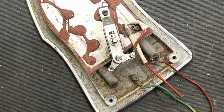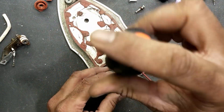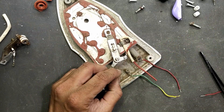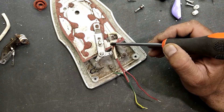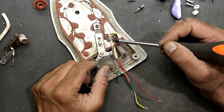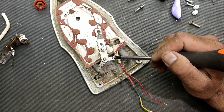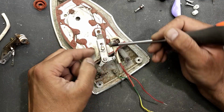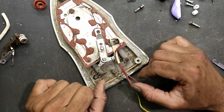The thermostat's second end will go to the heating element, and this wire will go to the heating element's second end — thermal fuse. This is a protection: if at any time the heating element overheats, it will open the circuit so the line voltage will not pass. Then if the thermostat is on, we set it to a specific temperature, it will close the contacts and current will pass through the thermostat to the heating element.